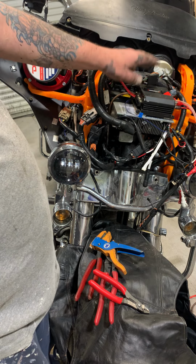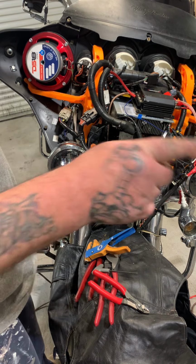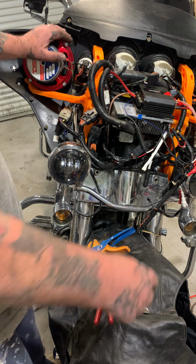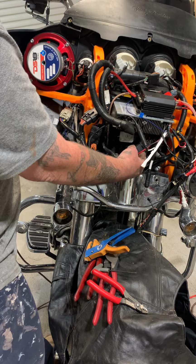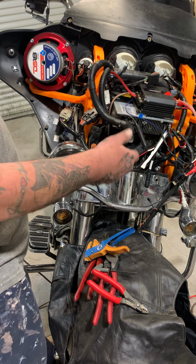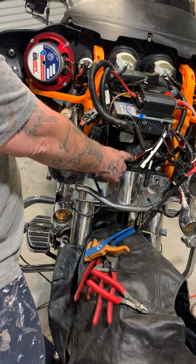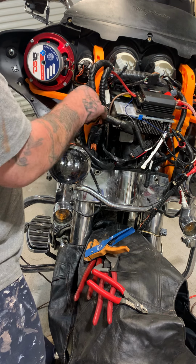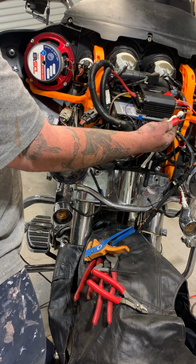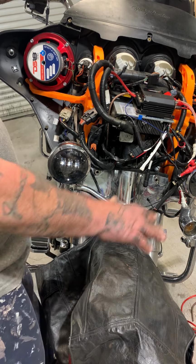Okay, hot, ground, remote. It's done. So all I need to do is tie into the front speakers. This customer has run his own; there's a volume control on the back of these bikes, and it's all eliminated. He direct wired it himself, and I have the wires up here that he used. So I'll be able to eliminate the Harley Davidson wiring, because I'm already tied into the low level outputs. Ooh, there goes my tools. But anyway, all of our power is run.